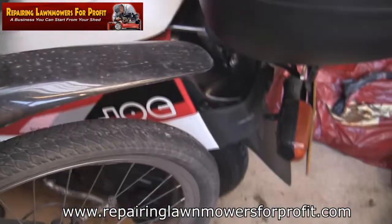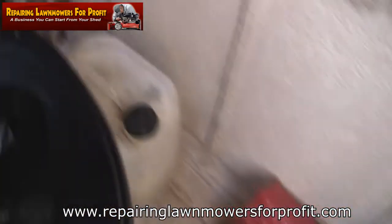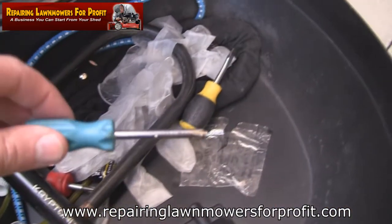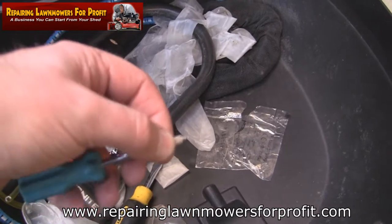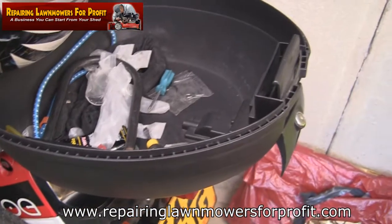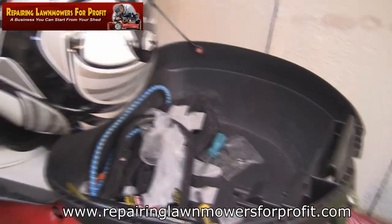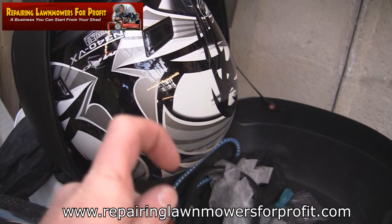I noticed that the mixture screw — I would set it with a little screwdriver that I've got. I keep them in my box because I've got all my bits here. I actually considered selling this bike at one point because I want a Honda Vision — I used to have a Honda Vision. But I keep a couple of screwdrivers in here just in case anything happens or I need to alter anything. So I was adjusting this mixture screw and looking through the gap and it was riding okay for a corner or two. Then I looked again and it kept bogging down and cutting out. I couldn't understand it, but I noticed that the screw — I'd move it out of the casing of the carburetor about that far, and then a minute later it'd have wound itself right back in the casing.